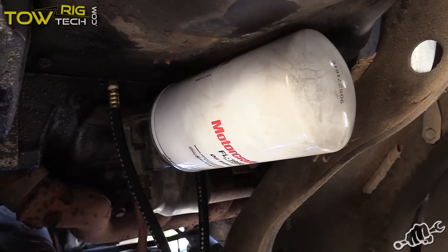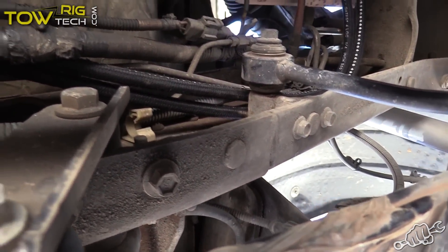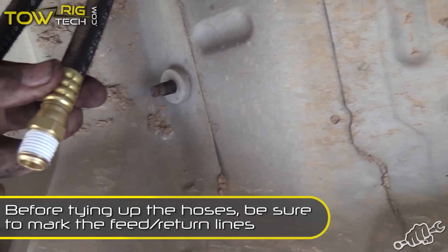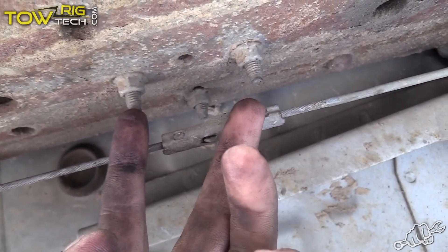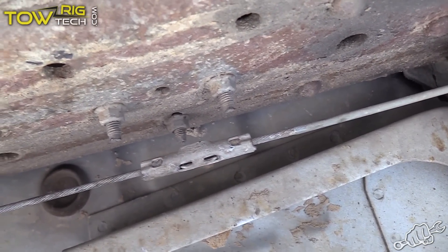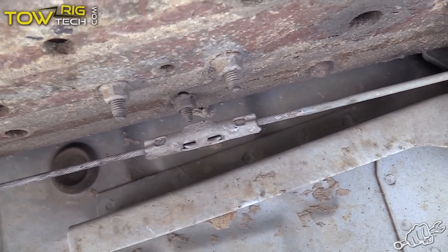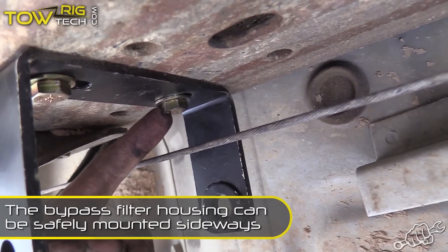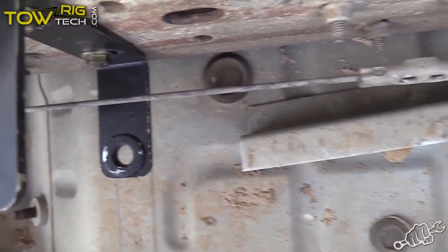As you can see, we have our new oil filter installed. We've got the lines ran through the frame — we're going to put a couple zip ties on to keep them out of the way of any moving parts. Ran over the top of the frame and they came out here. I went ahead and marked the low pressure line with some Teflon tape so we know for sure which one's the low pressure line. On a Ford, you can mount the filter vertical using these two bolts right here and you don't have to drill any holes. But I didn't like how far the filter hung down, and we go off road and pull a trailer off road, so we didn't want that to be an issue. We found this top hole was already in the frame, used it, put the bracket into place, and then drilled another hole in the frame. That way ours will sit sideways and it'll be out of the way with no clearance issues.